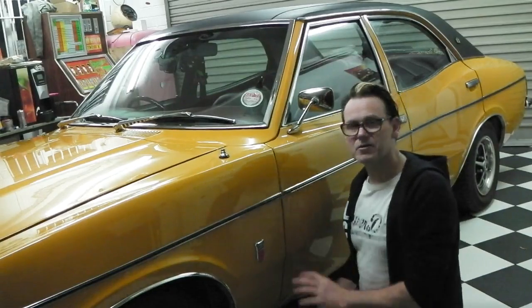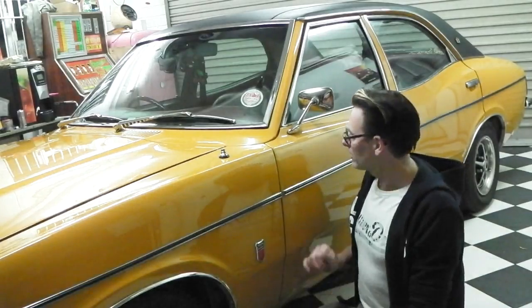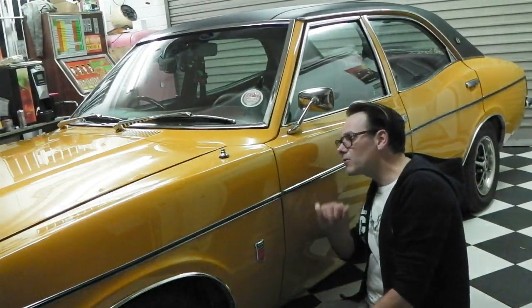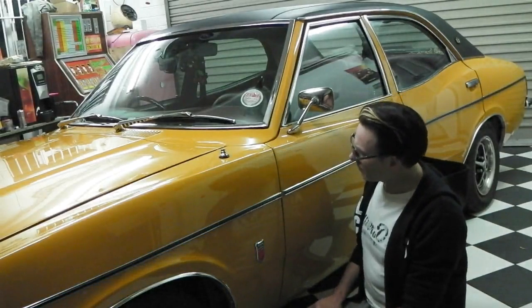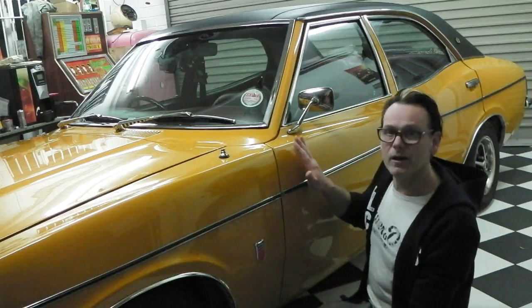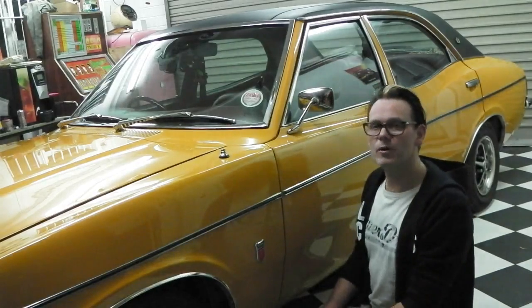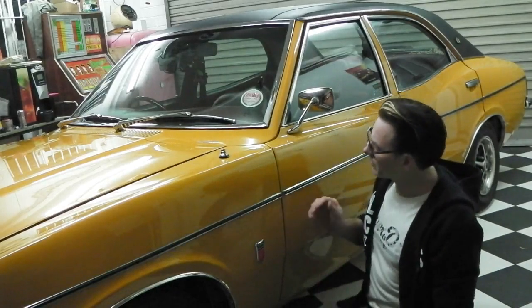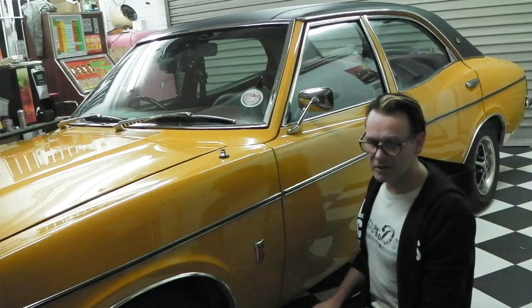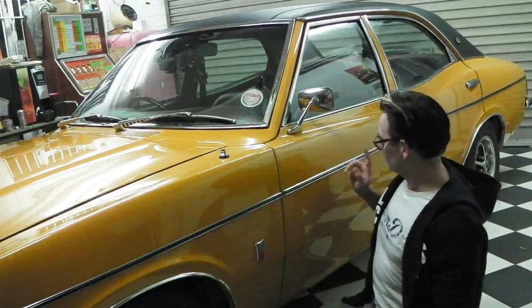What we're going to do next is very light on the G3 buffing compound, just to take any swirls out and stuff that might have been missed when it was initially machine polished. I don't think they were, but we'll very lightly go over the panels. Then we go Meguiar's Ultimate Wax, then Meguiar's Quick Wax. Changing cloths, changing our microfibers, and we're off. So, a little break for you while I get on with this.